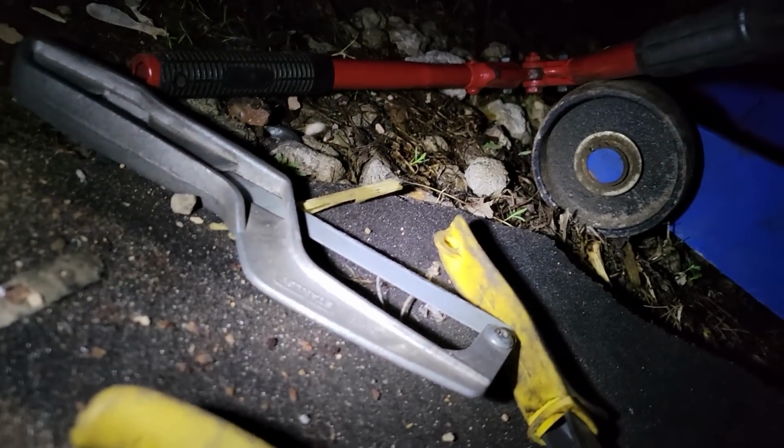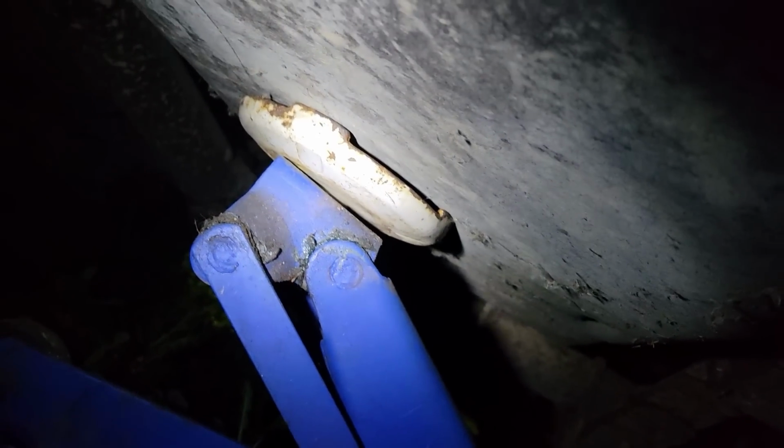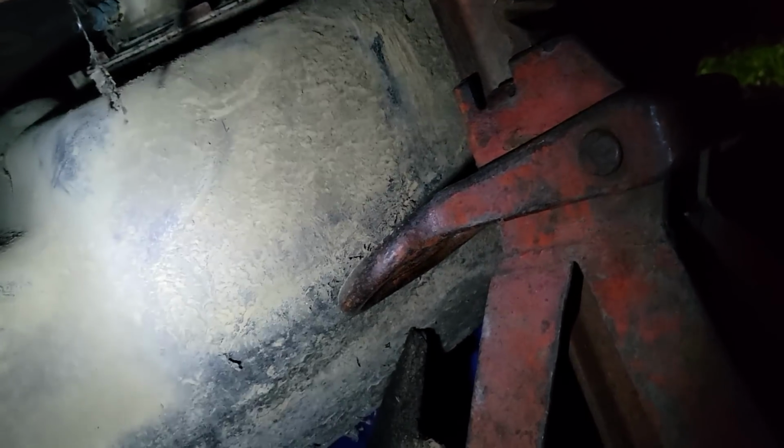Well, naturally, I had to cut through the good fuel strap. That one back there was rusty. So I cut it by hand because I didn't want to, you know, blow myself up. Something about preservation or whatever. Cut it to where it was weak enough that the tin snips could snip through it. And both fuel straps are out. I believe it is resting on the jack, so I'm going to lower it. Disconnect down right now. I popped the quick connect on the fuel line off. I just got to get the electrical connector out.